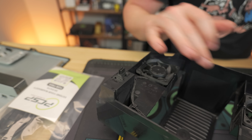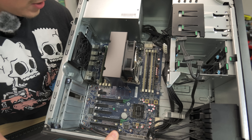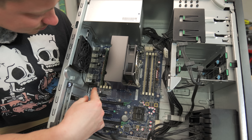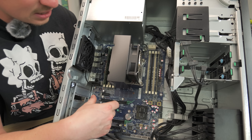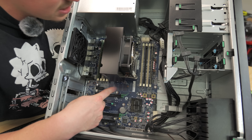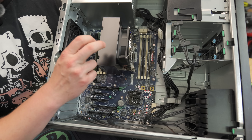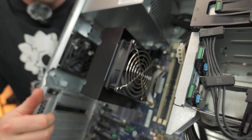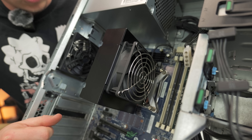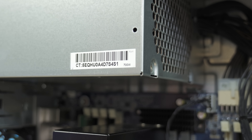There's a little fan that connects with a six-pin inside here — double fans, actually, to cool the RAM. As you can see, we have two SK Hynix sticks of 2666 DDR4, both 8-gig sticks. You can add up to eight sticks of RAM inside this build, which in theory could be quad-channel. There's a really large aluminum tower cooler with a slightly smaller than 120mm fan, which is super adequate compared to other cooling solutions we've seen. This power supply looks massive — 700 watts, quite a bit to work with.